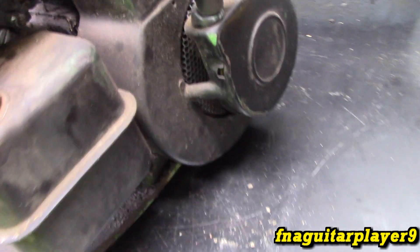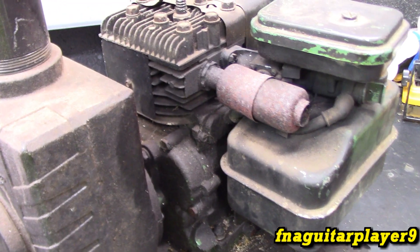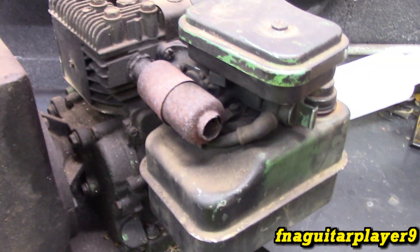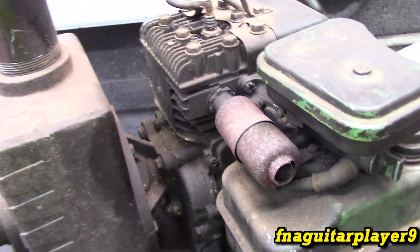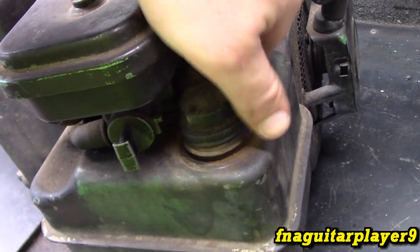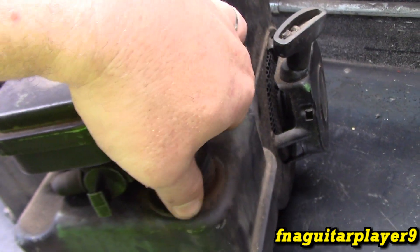It's been painted — it wasn't green, so it's probably a Coleman brand. The first time I used it it was a little cool outside, which was helping keep this problem from happening. I ran it for a good three or four hours solid non-stop. On a warmer day it'd run for about 20-30 minutes and shut off. Finally got it started again after about 20 pulls, then it ran just a little bit. Initially I thought the tank was building up suction, so I took the cap off and it still did the same thing.